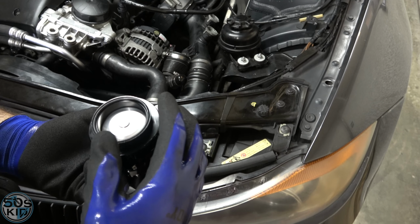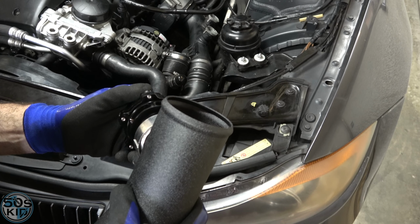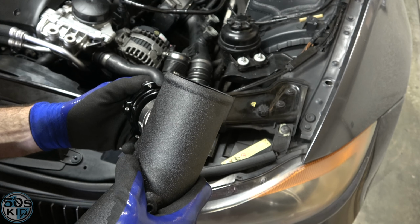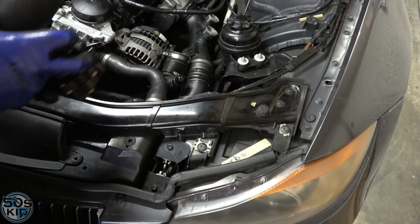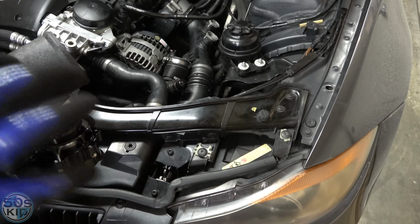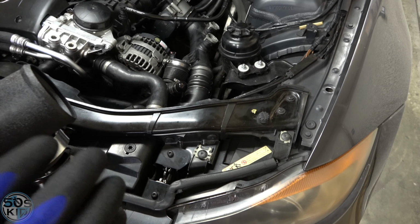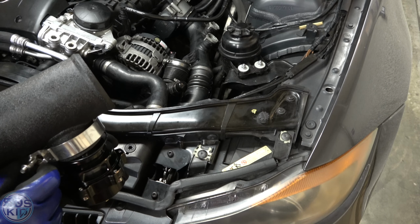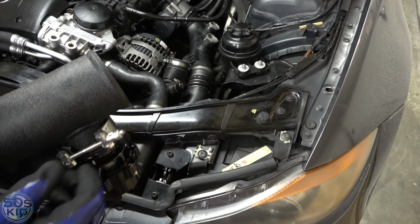I think this is going to take me a little bit of practice. I can see people having problems with this O-ring, pinching it in just the wrong way and having leaks, having boost leaks. So yeah, I'm definitely going to need to fiddle with this off camera, but you can feel when it slides in and it's nice and even, and you can feel when you didn't quite get it. So just make sure that you're sure, and then get the clamp around and get it all done. And it definitely helps to take the actual nut off of it so that the clamp is super loose.